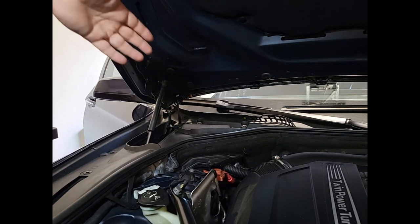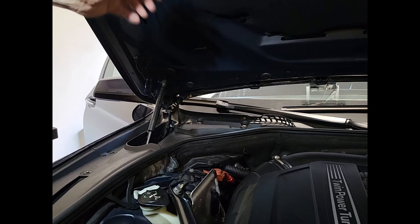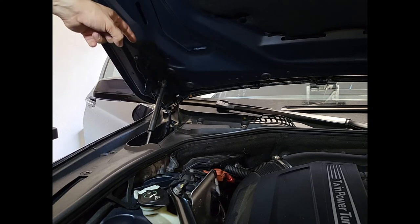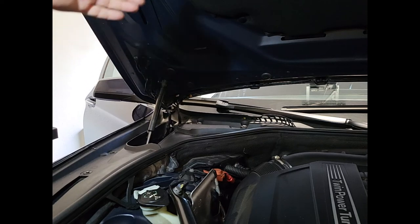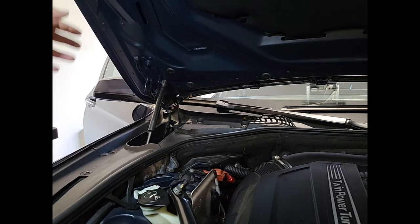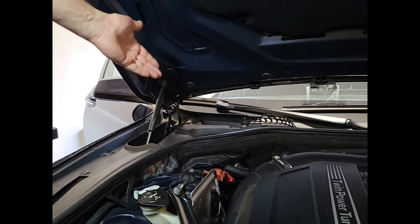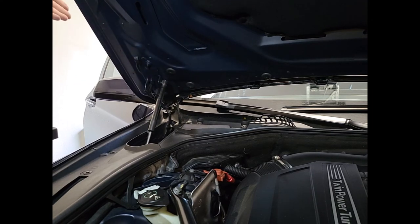When I made that video, I guessed that if I saw all that crap in the fan blower, most of it must have gone inside and got caught by the cabin filters. As you can see, my cabin filters were disgusting — they had the mesh filter material itself in there and dried up leaves. So just take the time — if you're doing this job, it's a must to do the cabin filters too. I did this job right after I heard the sound. The way you know your fan blower mesh is gone is when you turn on your AC or heating, you'll hear a humming noise.